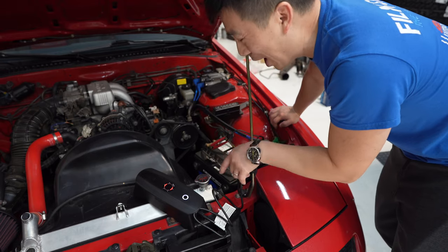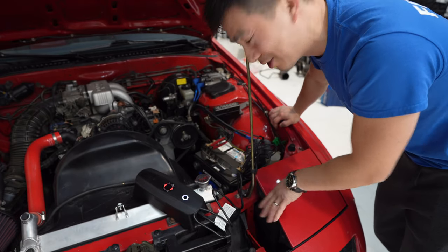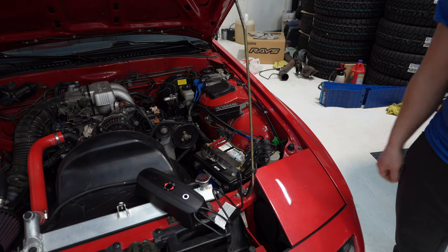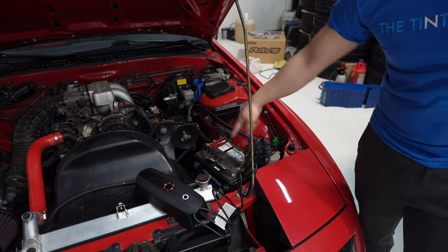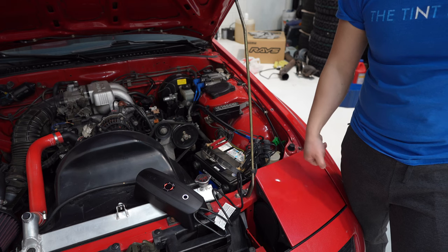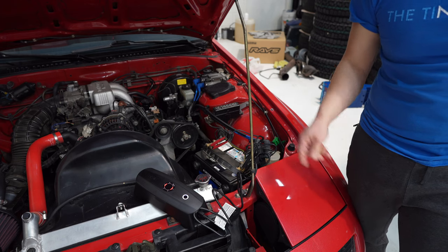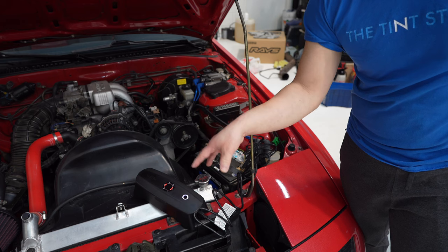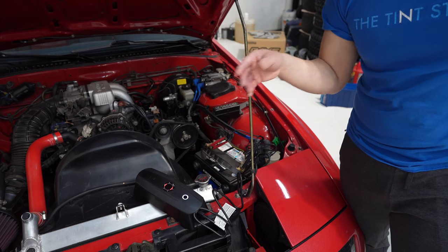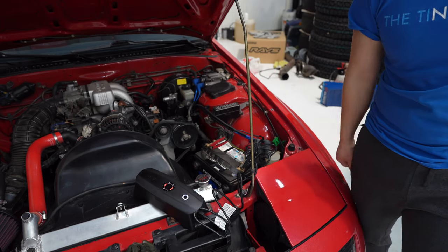The CS3 is basically analyzing the battery to see if it will take the charge. Unfortunately, this battery is toast - that's why it's lit up red now, saying the battery won't take the charge. So it won't start. CTEK basically says when you boost your vehicle, a lot of new cars have sensors or an ECU - you don't want to kill that. If you shock it with traditional boost cables, that's why this CTEK doesn't allow you to do that. That's smart. So do you have another car we can try?